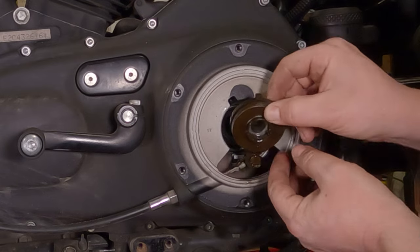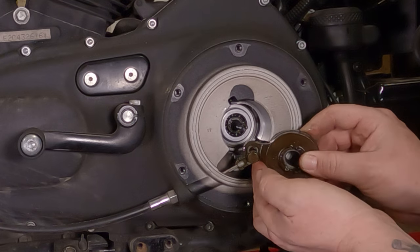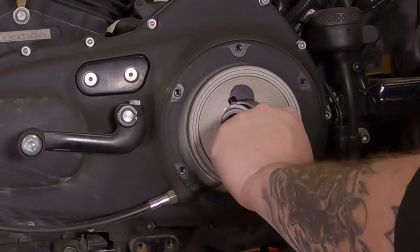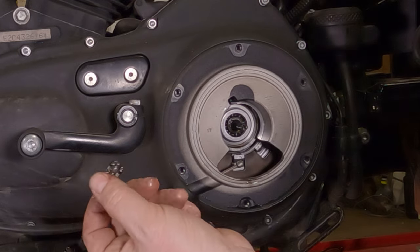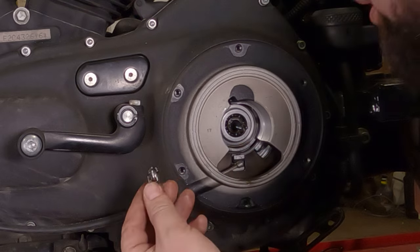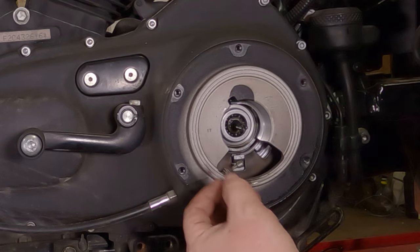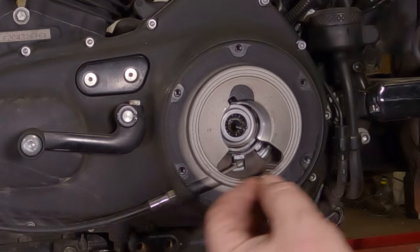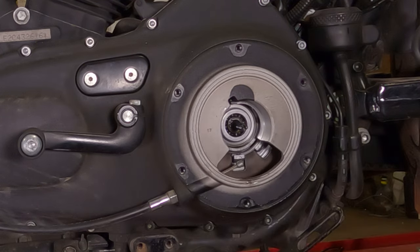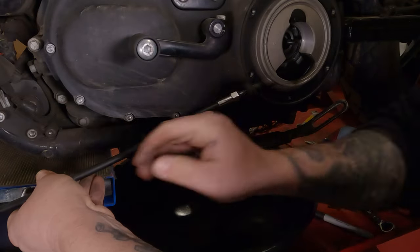Take this whole big disc and rotate it 180 degrees — you're going to get almost there and this piece is going to come off. This little lug here — do not drop this inside. It hooks right off the end of the cable; if you drop that inside, the clutch may stop it but if it doesn't you'd have to take this cover off anyway. These are internal engine parts — put them on a clean rag. You should be able to twist this sucker right on out of here.